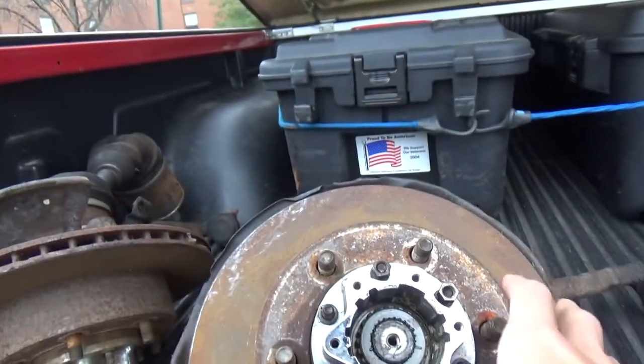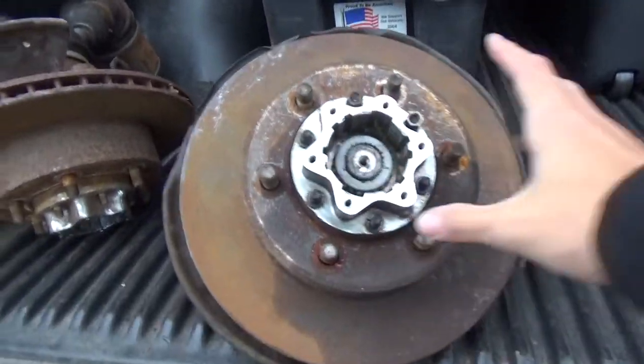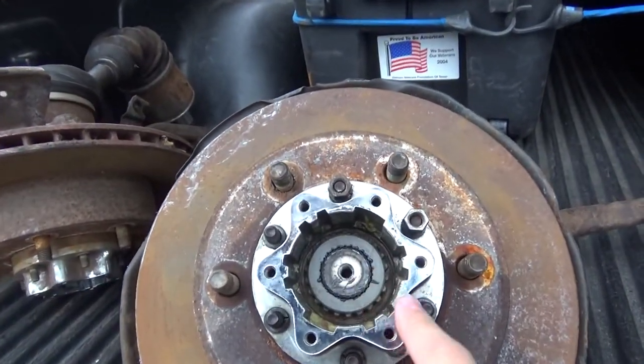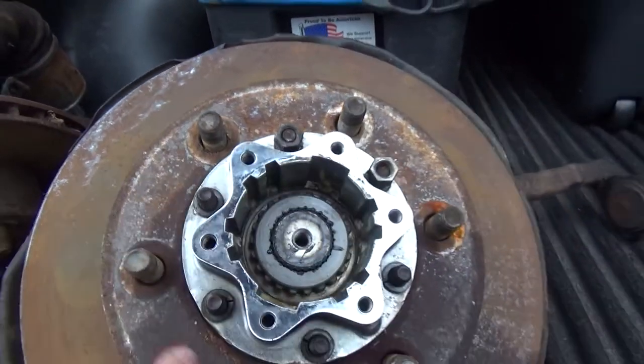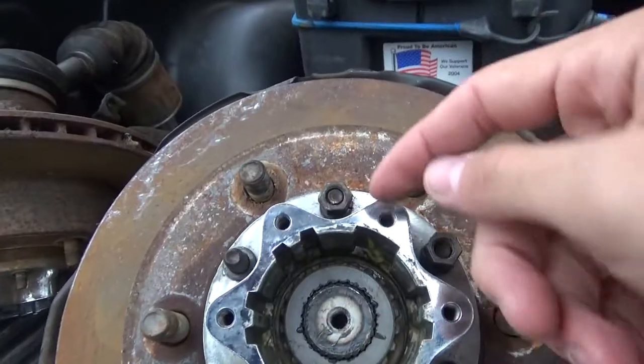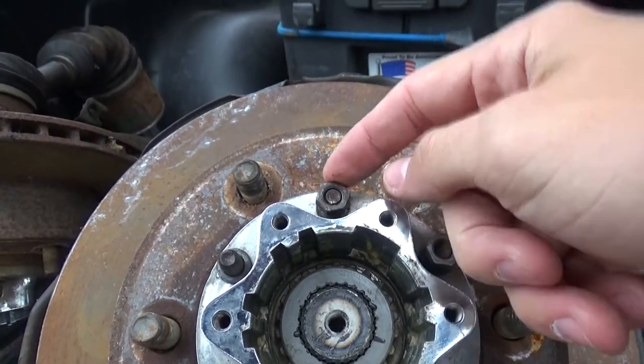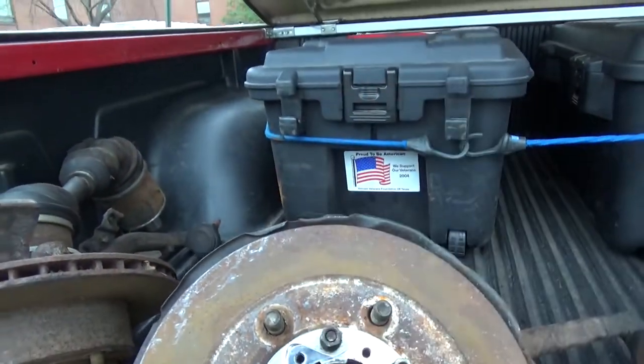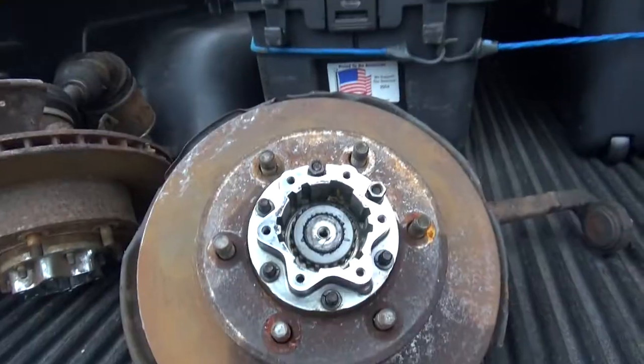This is the hubs and the assembly and obviously the CV axles back there, which is what we're trying to get out. So this assembly needs to come off. There are cone washers — what, six of them. The best way to do it is to align the nut here and then put the brass drift, which is basically just like a punch, on there and hit it and the cone washer will pop out. I don't have a punch set yet, so we're gonna go to Harbor Freight and get one.